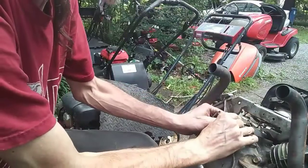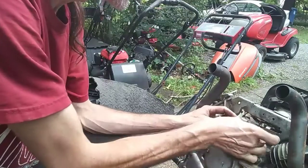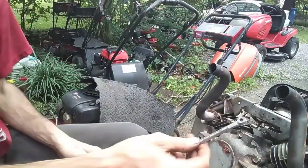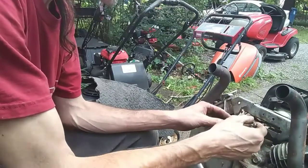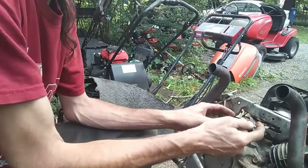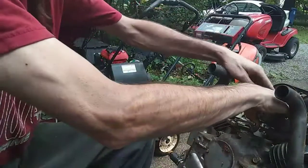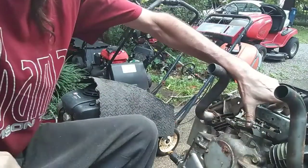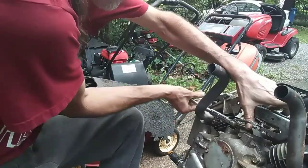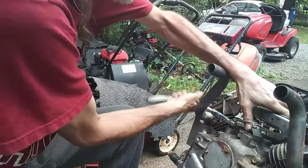So when we took it apart, we had this governor arm off. So put it back on, make sure your springs are hooked up. I didn't take any of this apart, I just left it laying. So take you a little 1/4 inch, put over here, and you want to pull this all the way back. That arm moves like this. So pull it all the way back to the left. Then you want to hold your throttle wide open, just like that, and then tighten this back up. Kind of tricky. You really need 3 hands, but you can do it. Don't break it.